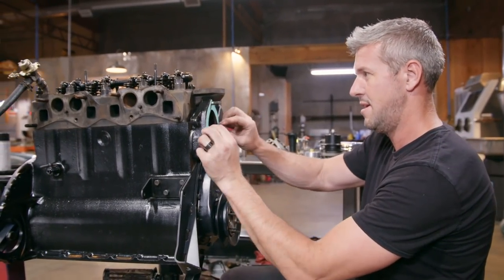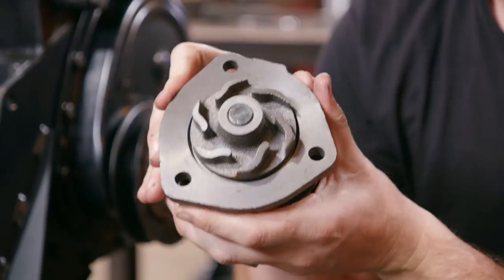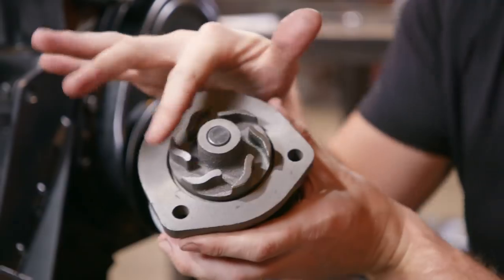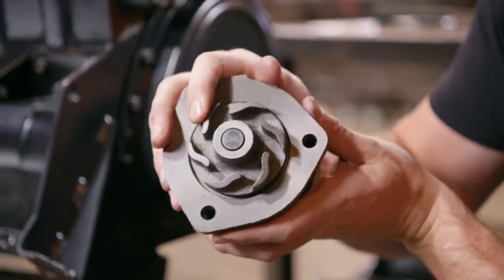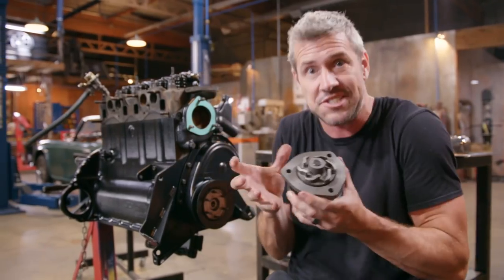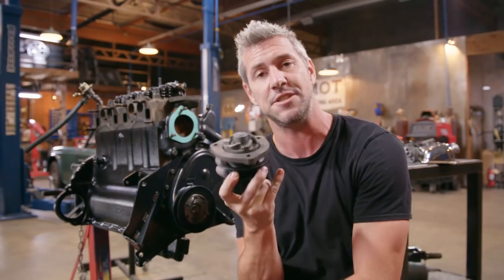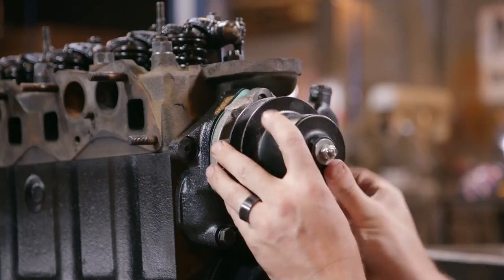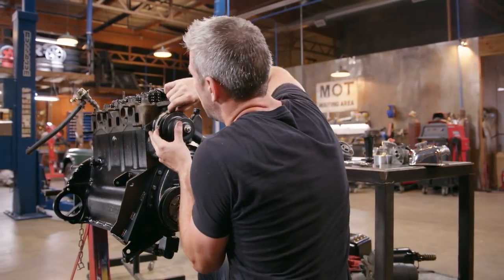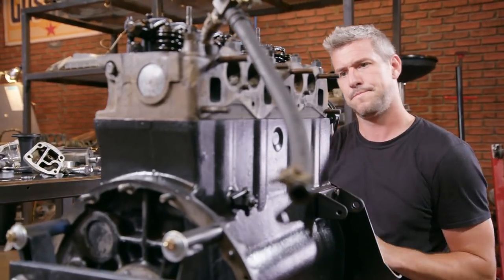Next up is my more modern water pump. If you notice, there are six vanes and they're all at an angle. This is enough to create centrifugal forces as it's spinning in line with the engine, and that allows pressure within the system. This tiny little space pressurises and feeds coolant to the entire engine — this is a nice little upgrade. An efficient water pump helps the car run cooler, which can not only prolong engine life but also help with power and overall engine and fuel efficiency.